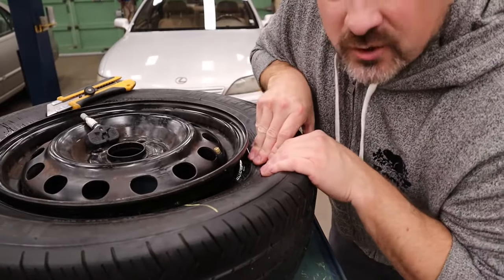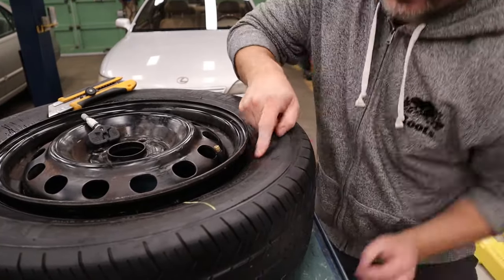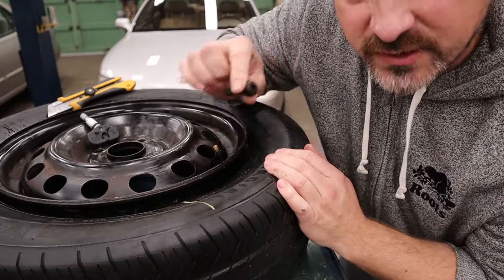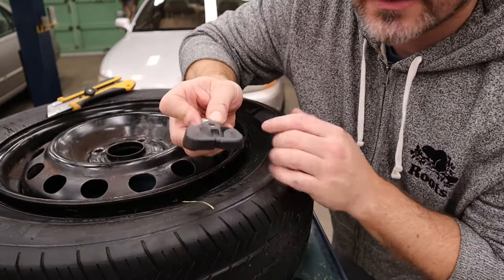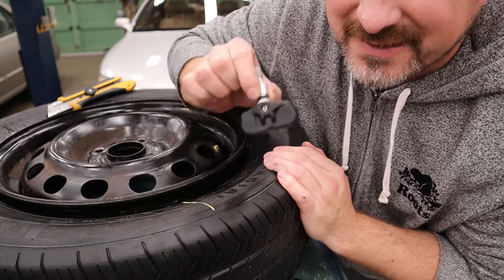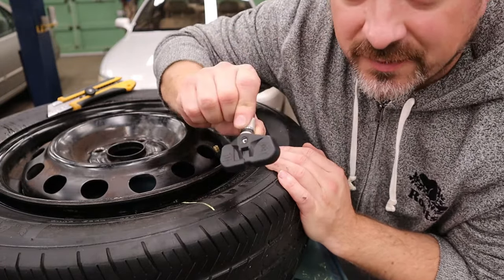Now that you can pull the tire away from the rim, look inside. If you see basically a round rubber knob it's just a regular valve stem — you're good to go, we'll just change it out. However, if you push this back and you start seeing a big plastic piece on the back, that's a TPMS sensor, so this becomes a more costly job and you'll need to replace a TPMS sensor. If you haven't already, watch our TPMS videos for help with that.